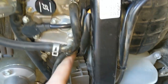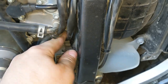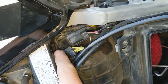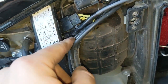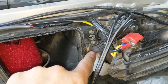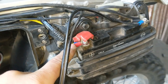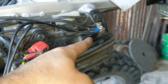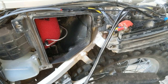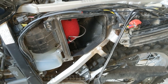Make sure no water or dust gets in there and tuck it back up. It's going to feel tight because it impinges on the back side of the rectifier — that's normal, that's how it is stock. It's a tight fit, but you go up through here, behind the frame, out toward the back side. My wiring loom connection runs right through here with plenty of room, and the fuse is placed back here as well. Then we made our turn to get to the positive, and the negative goes to the battery. I'm going to hook everything back up and start it to make sure it runs before buttoning everything up.